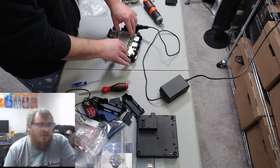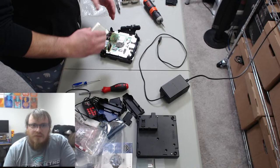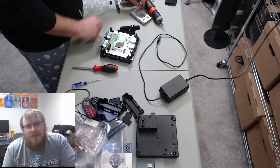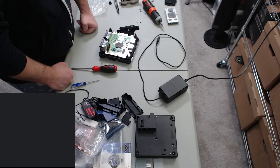All right, well, it's already getting looser, so that's a good thing. And it's starting to get hot, so let me unplug it now. And now let me try. There we go. I messed up some of the gunk on it, though. Just see how it is. A little bit there. You should be fine to reassemble it as long as you get where the gunk is, and we can at least get it tested. I'll get you the links to the new thermal pads. You can just cut your own thermal pads to put over it and replace all of it.